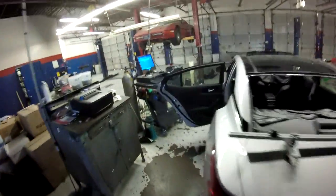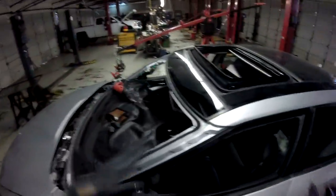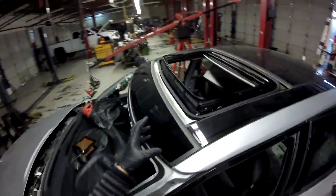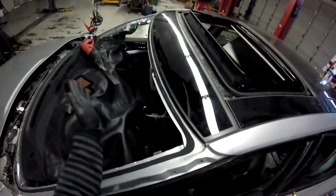Remember, usually when it's summer, it's really hot weather, I use just the water, okay? But today I'm gonna use that. This product is what the dealers use a lot. It's no soap, it's an anti-grease product, but I have to use it because if I use water with this cold, my blade is gonna trap. When you start cutting, it's gonna go inside, and it's really hard, so I cannot have the control of that machine right there. So I'm gonna use a little lubricant just to make the blade go free.